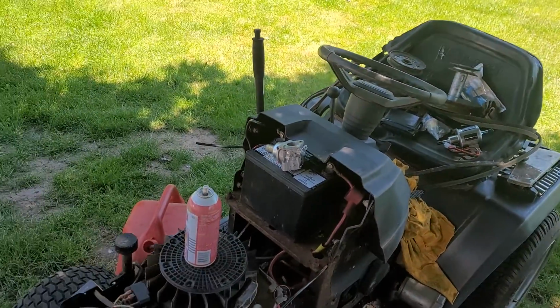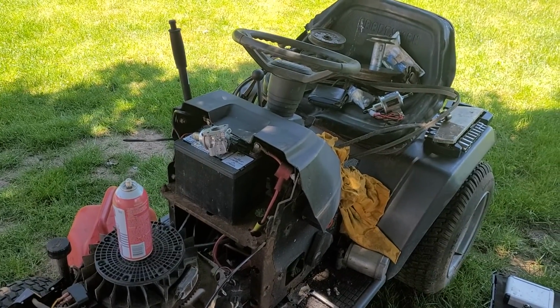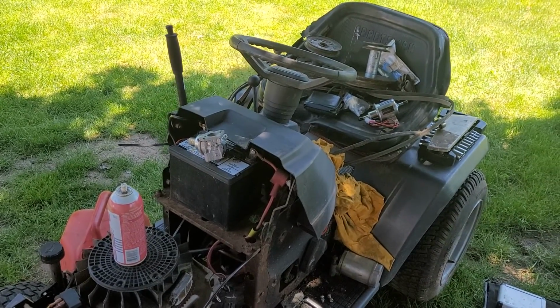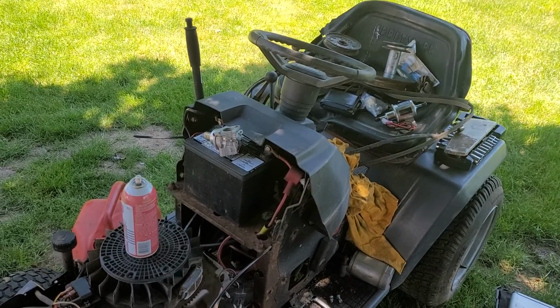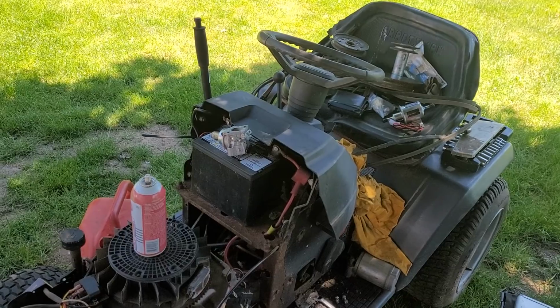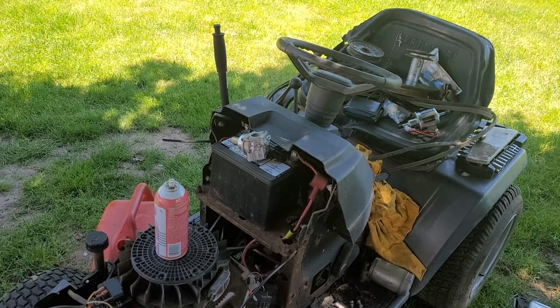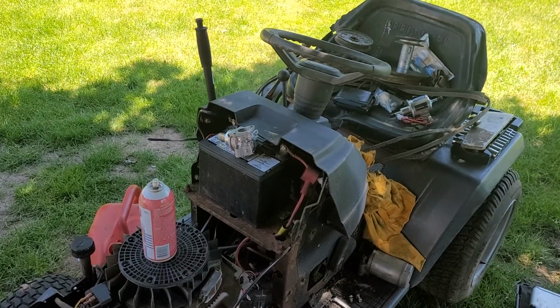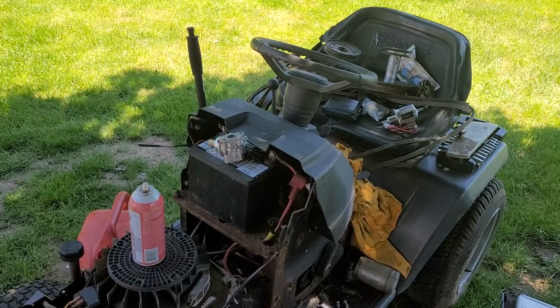But fuel pump, very easy job. Just make sure you have the in to in, out to out, wire it in. Make sure it's on key on power. Obviously, you don't want it to run constantly unless you have a return system and you want to kill your battery. But key on power, and that's pretty much all you really have to do. You don't need a fuse. The fuse in the actual machine will take care of the pump as well.